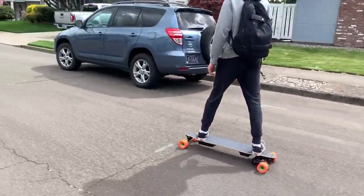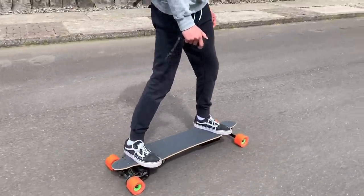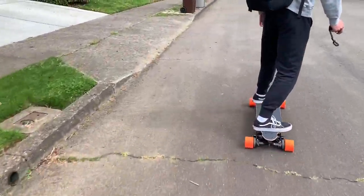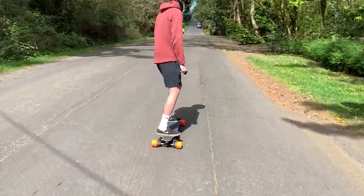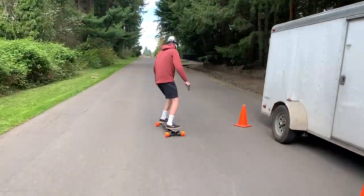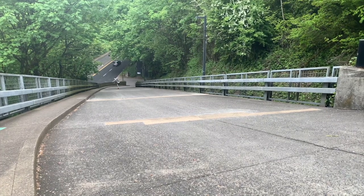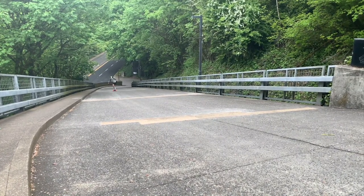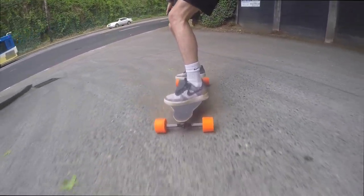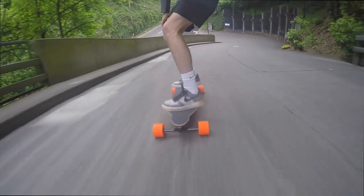So there you guys have it — that's how we built this DIY boosted board clone. I'm honestly more than happy with how this build turned out. It looks pretty good and I think I might mistake it for an actual boosted board in the streets. It feels incredible to ride, and we can credit this to the flexible, high-quality Loaded Vanguard deck — there's a reason boosted used it on their V1 and V2. The carving is absolutely incredible and unrivaled. The power is insane; it absolutely kills any hill, including one over 30% — by far the steepest we've ever tested — thanks to the 15-38 tooth gearing with 85mm wheels.